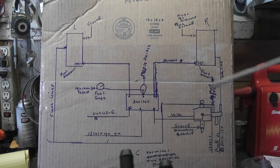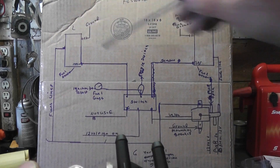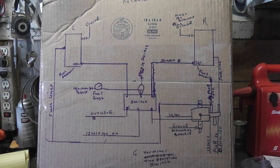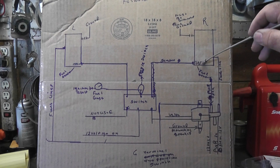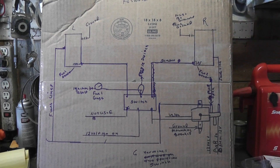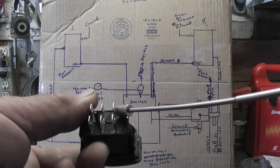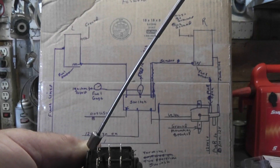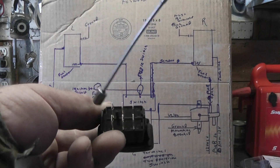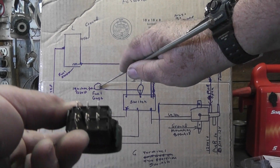The other one here will go over to the left tank, so that one goes over here to the left tank. We've got the outlet here — that switch for the valve. Fuel line goes in there. Here's your sending unit for each tank. For the right tank, the sending unit plugs in here; the left tank, it plugs in here right there.